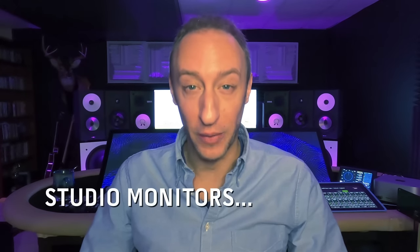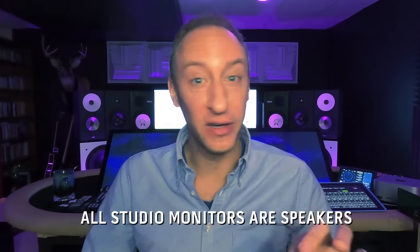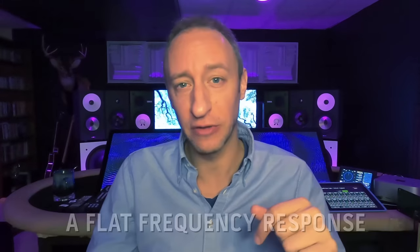So let's jump right into it — studio monitors, speakers, what's the difference? It's like the old saying: all scotch is whiskey, but not all whiskey is scotch. All studio monitors are speakers, but not all speakers are studio monitors. There are certain characteristics that make a speaker a studio monitor. The shortlist is your frequency response — studio monitors typically have a flatter response, more even across the spectrum. They're not hyping certain frequency ranges. What you're looking for is the most realistic reproduction of that original recording. If you have a speaker that is boosting or cutting certain things, you're going to be adjusting for that in the mix, and that isn't going to be as accurate. That's why you need a flat speaker.